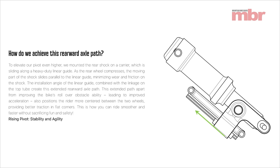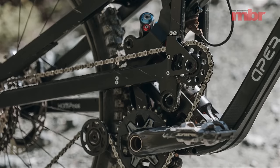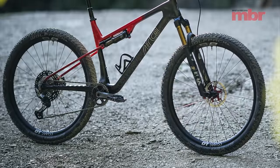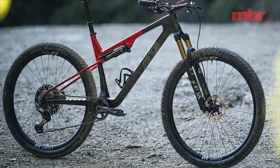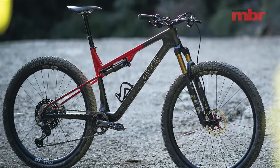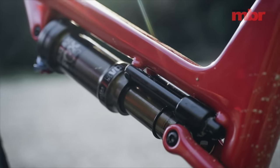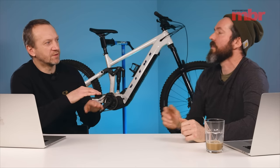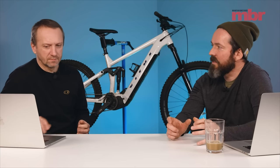What's interesting with the rail is that the pivot goes up and back as it goes through the travel, giving a more consistent rearward axle path. It's an idler design because with such a rearward axle path you'd have crazy pedal kickback otherwise. It's a twin-link bike — a rail and a link — and the bottom rail acts like a super long pivot. This links in nicely to Arc8: if you think about a really small link having a tight radius and lots of variation, and then you make the link longer until it's infinitely long, it's flat — that's a rail. So you're keeping the leverage really consistent, and it's also really light because you're effectively eliminating the link.